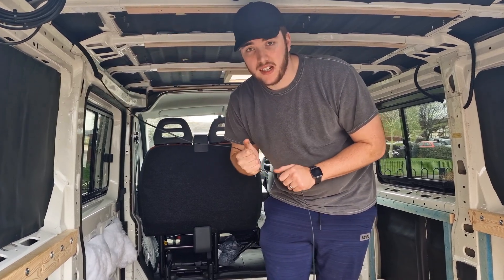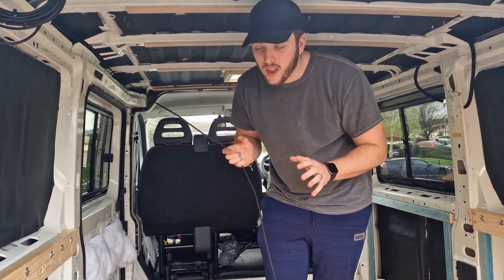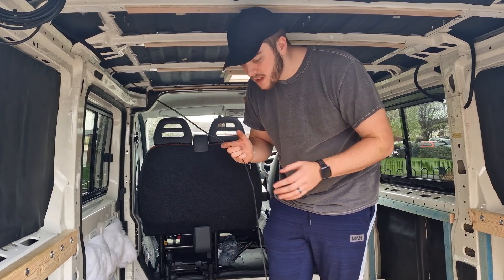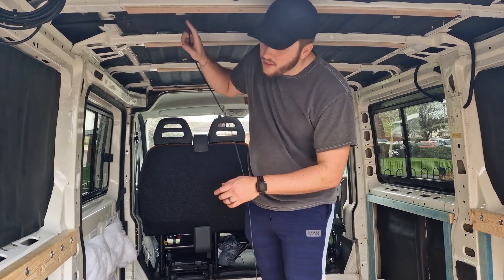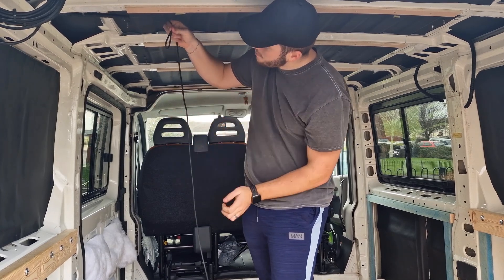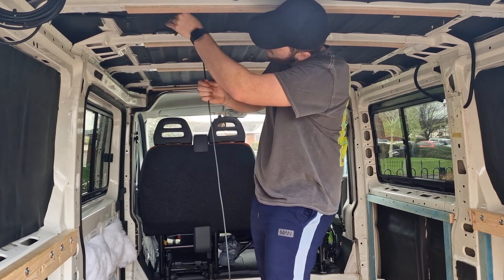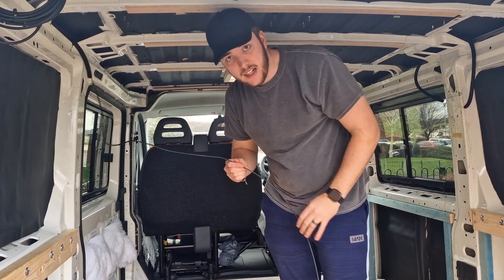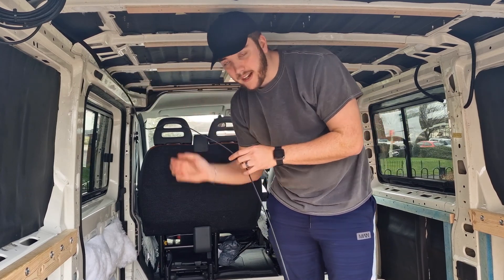This wiring circuit — all four lights — are going to be run off the same circuit. In order to do that you can wire them up in series or parallel, but you'll get a voltage drop if you wire them in series. So what I'm going to do is: right here is where I want the first light, so I'm literally going to be making a little loop that, when I come to fit the lights, I'll just cut. I'll tape that up there and then run to the next light. I'll do that for all four of them, meaning the last light is just going to be an end of wire — running through all four lights and then back to the battery.